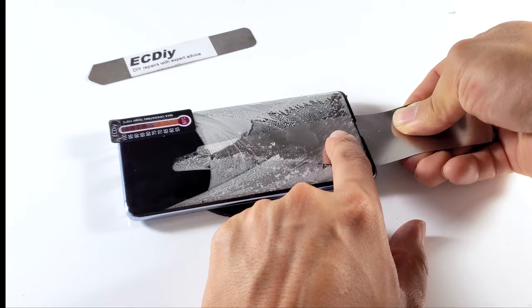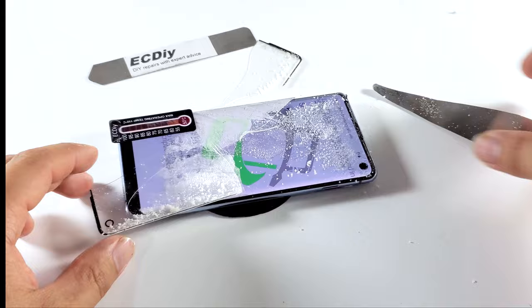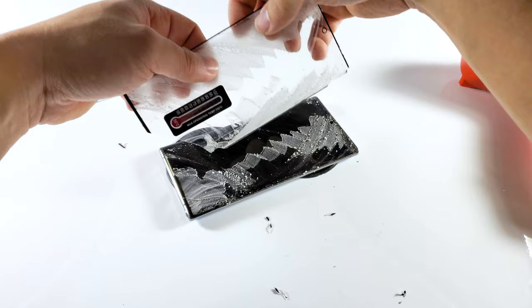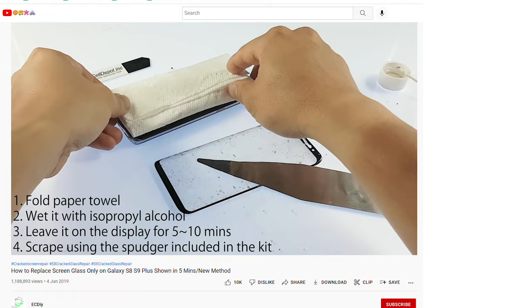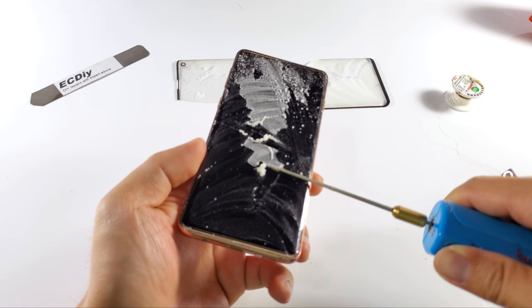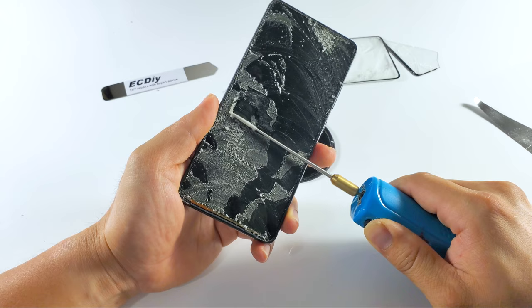You can still use the OCA blade exclusively, but the new method is definitely easier. When it comes to removing the glue residue, the method shown in the previous video still stands, but this can be quite tedious and time consuming. I'm going to use an electric glue remover here to save time. We offer an inexpensive battery-powered version for those that want to save time — if you think you'd be doing this repair more than once, I highly recommend it. You want to remove every trace of the adhesive.